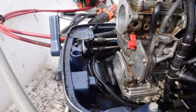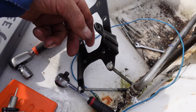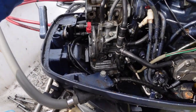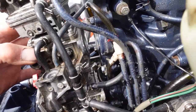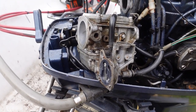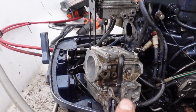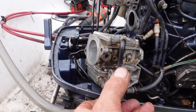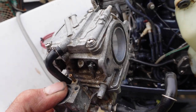To access this cold start gizmo you have to take off the carburettor clamp plate, which means undoing all 6 screws and loosening the carburettors — which isn't really something that I wanted to do. As usual, it's by doing things that you find out how to do things. The thing to do is leave that plate on, loosen the top screws and the bottom two screws, take the middle screws out, and then after you've undone a couple of pipes you can withdraw the whole carburettor.